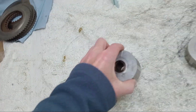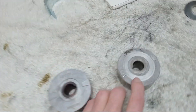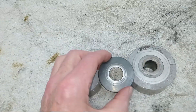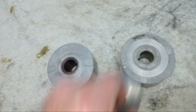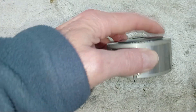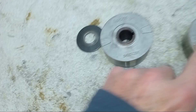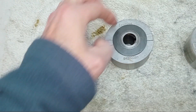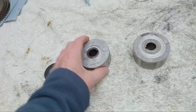The only other thing I'm not sure about: if you look at the original rotor it's been cut away here, whereas the replacement hasn't. This is the conical washer - a sprung locking washer - and I think it's been cut away so the washer can sit flat. On the new one the washer only sits on the timing marks and there's a gap underneath - it doesn't sit flush. So I'm probably going to grind the ends off the timing marks just so the washer will sit flush all the way round.